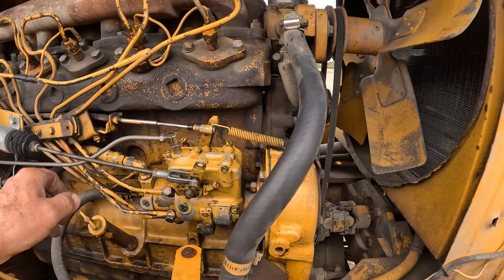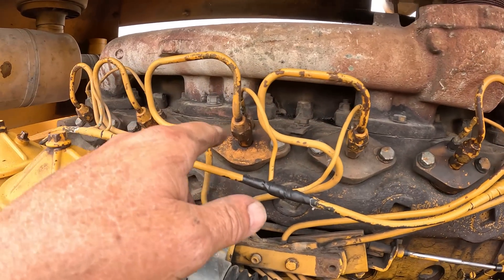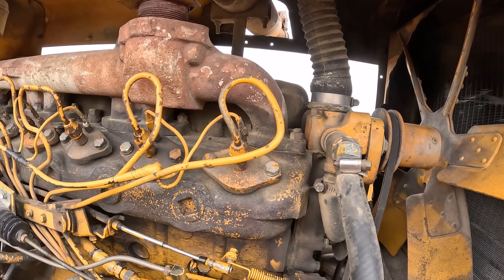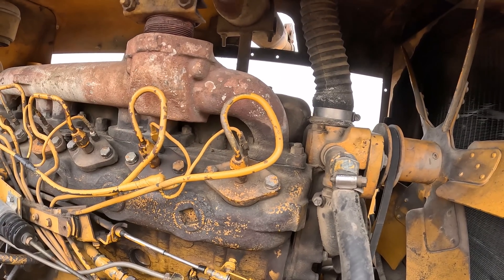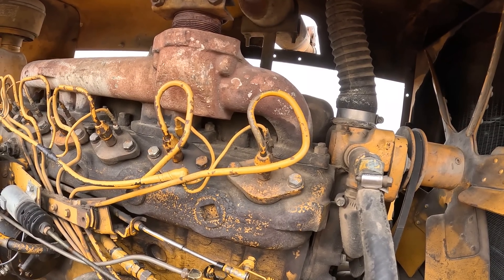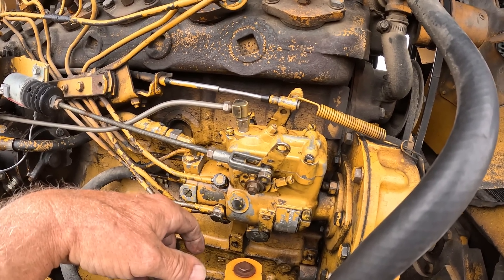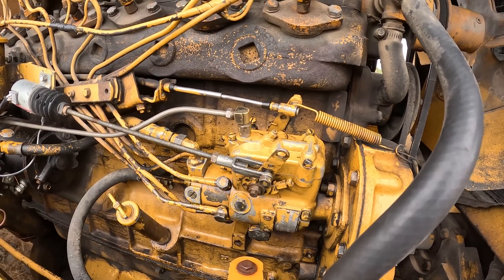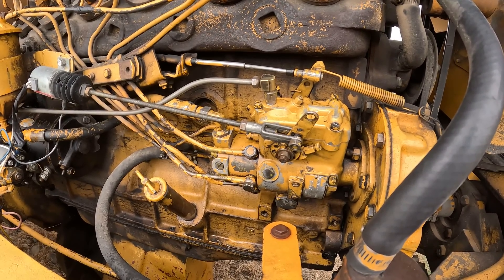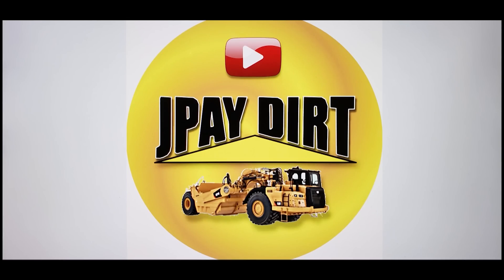Anyway, the motor's water is warm - can't beat nothing like warming it up with a can of ether. Things are hot. Got a little fuel out of that one and a little out of that one, but that one never saw any. Matter of fact this one's absolutely dry - even dry down in the injector hole. This injector must leak pretty bad - it actually dripped all the fuel out of it I suppose. At this point I'm just gonna stop messing with it. I'll go rent a crane, do something - whatever I gotta do. I know we're gonna get busy with work here soon, so I need to get a lifting device, get that motor out, get my engine stand built. To hell with this gallon of junk.